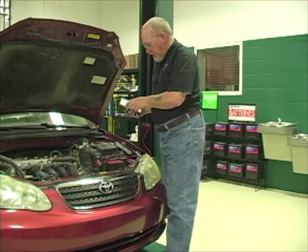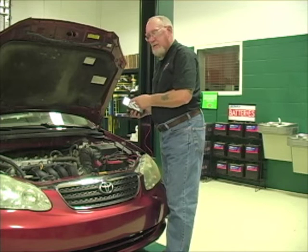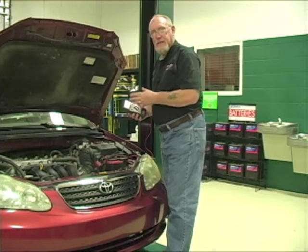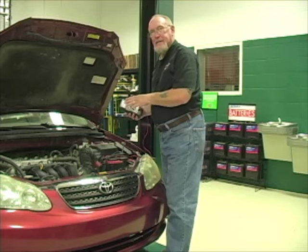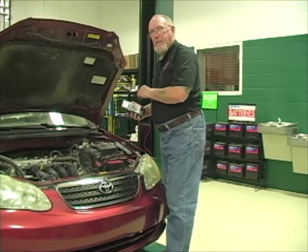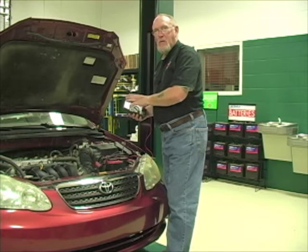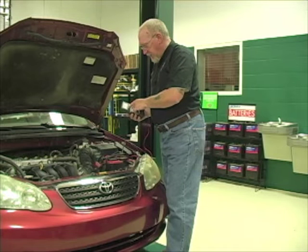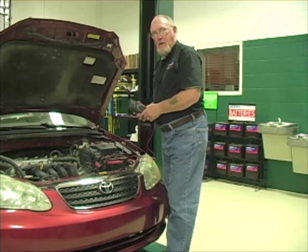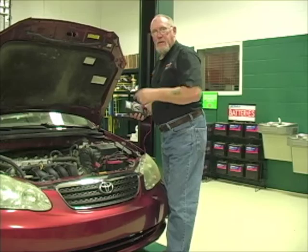When I'm done, I'll hit the record function — that's going to give me the maximum reading. In this case it's 13.7 volts with the lights on; that's not too bad for a charging system. Hit it one more time and that's the minimum reading — 9.8 volts. That's above the 9.5-volt threshold for a loaded battery test. And then when I clear the record function, I get the open circuit voltage — the current state of charge on the battery itself. That gives me a rough overview of the charging system, but let's see what difference the scope makes.